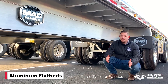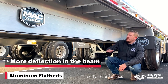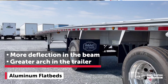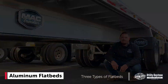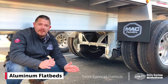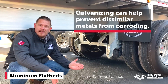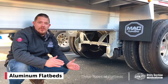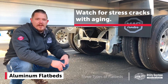Here are some other things to consider about an aluminum flatbed. Because it's comprised specifically of aluminum, it's going to have more deflection in the beam, so you're going to have more of an arch in the trailer. The crossmembers need to be closer together to support the additional weight because the aluminum deflects. Aluminum is going to hold up better to the elements up north — you're not going to have issues with rust. However, you can have issues with dissimilar metals corroding together. We addressed that here by upgrading with galvanized suspension hangers. Also, as these trailers age, you can deal with some cracking due to the stress of that flexing, especially in the suspension hanger area, so keep an eye out for that.